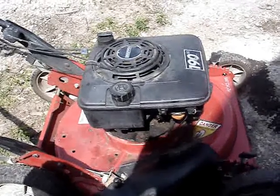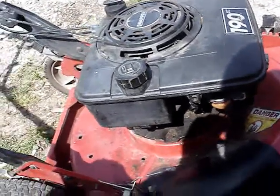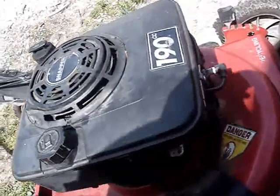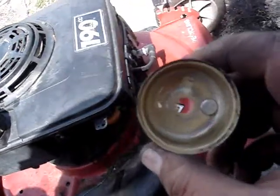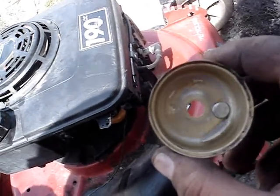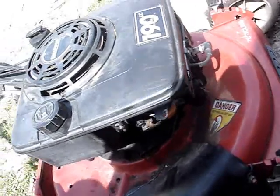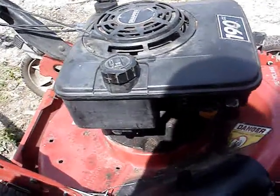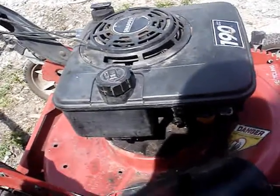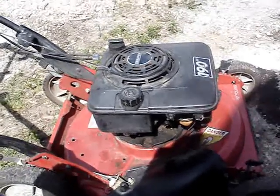Here's something interesting. I just cracked open the carburetor bowl on this Snapper lawnmower — non-self-propelled with a Quantum engine. One of the welch plugs fell out of the bottom of the carburetor, so I'm gonna have to remove the carburetor and press it back in if I can. I've never seen that before. It had a choke problem but I fixed that — I needed to adjust the throttle lever for the choke to work because there's no primer on it. And yeah, it does run.